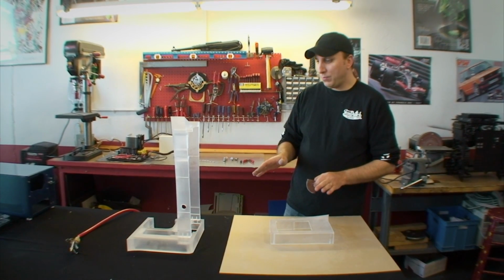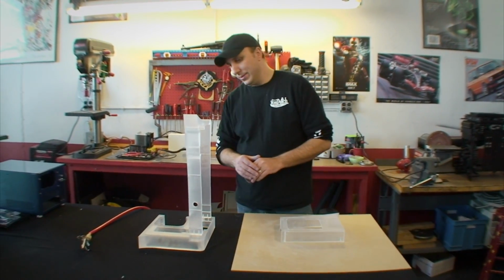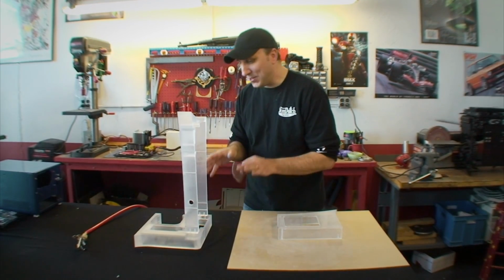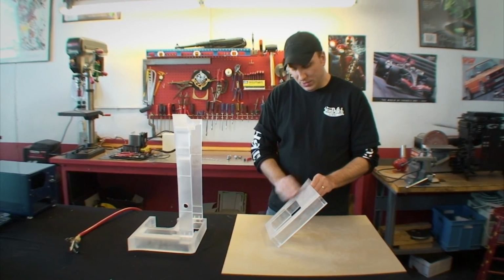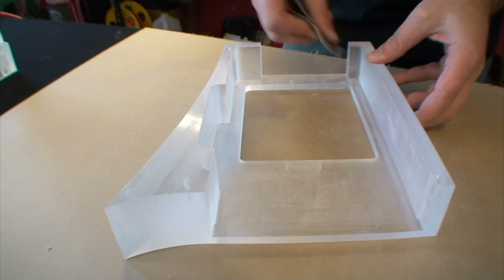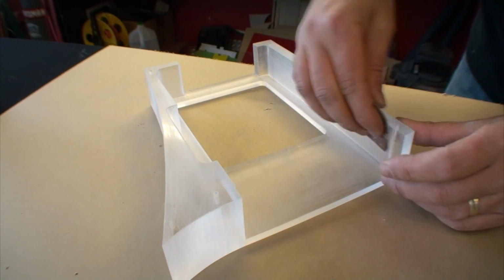We've got the main portions of the build for the ModMen PC finished, and that is the acrylic, and here you can see it. Now it's got a different look. It's frosted acrylic now instead of clear acrylic, and the reason being is that I'm sanding it all. What I'm doing is medium grit sandpaper, just going over the cast acrylic so I can create an adhesion coat, because we're going to go over to Brad's next, and he's going to paint it for us.